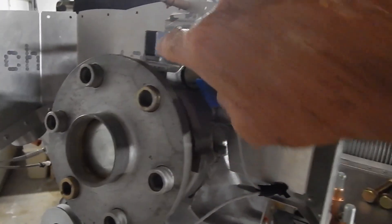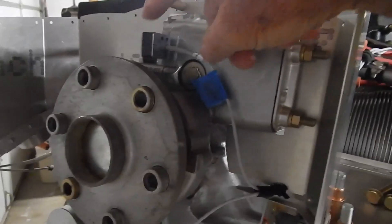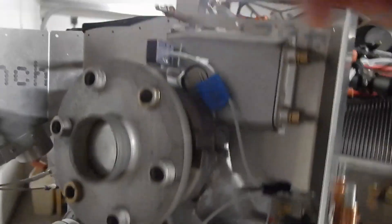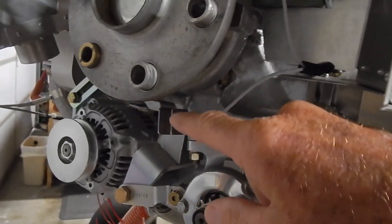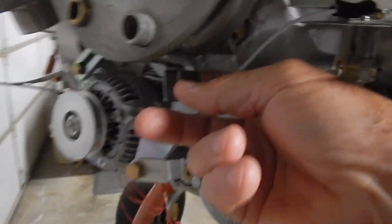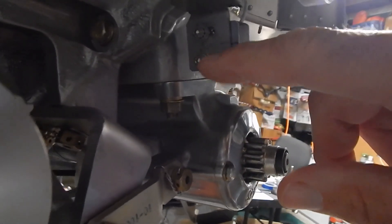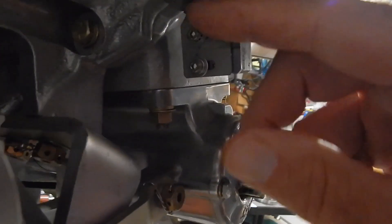This is the next test I'm going to perform. There's a channel A and channel B — one on top, one on the bottom. As the flywheel goes by and the magnets pass the sensor, that creates a spark in the coil. I can get spark from both channel A and channel B through both coils on the top sensor. There was some discussion that sometimes these brackets are not placed in the right location — Klaus from Lightspeed indicated that even though you can only move them forward and back to set the gap, if the bracket is not at the right height it sometimes has to get bent.